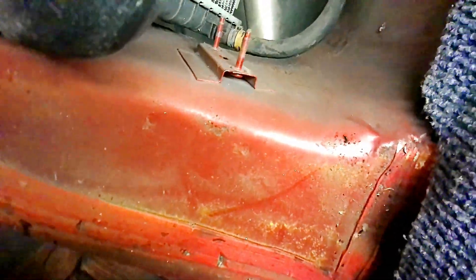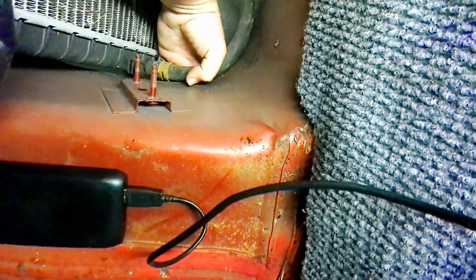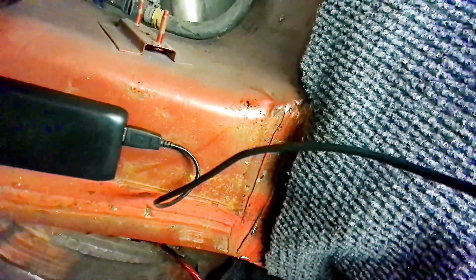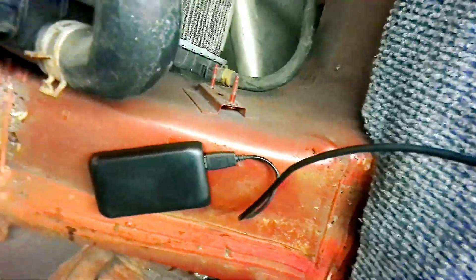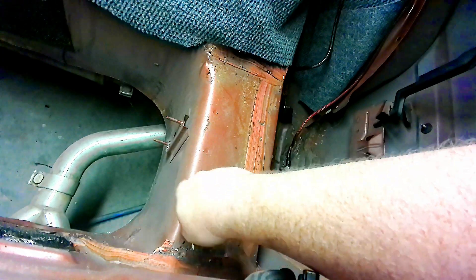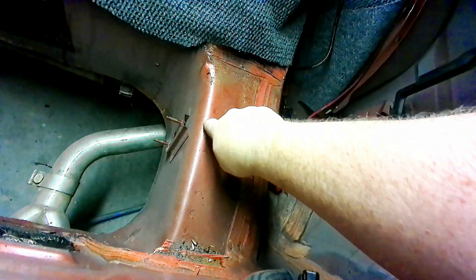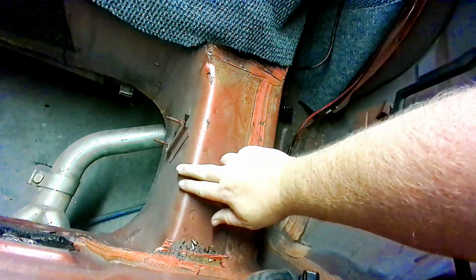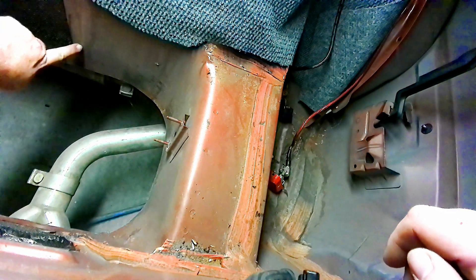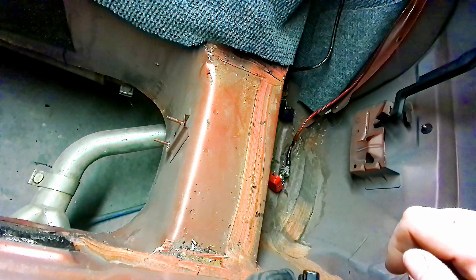The radiator will pass where I have it cut now. At this point we're just carrying extra shrouding and weight we don't need, so I'm going to lay up underneath and cut more off. Our frame rails start basically in here — I can see something spot-welded here where it's just two pieces of sheet metal. I'll probably come right up to the top edge of that, maybe leave the radius piece for a little strength. I can't go too far back because I have my gas tank straps coming down to about right there.